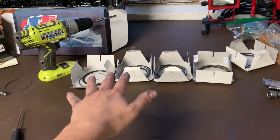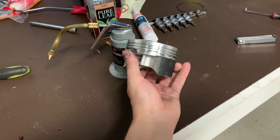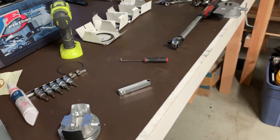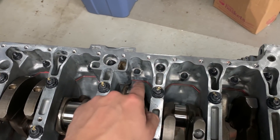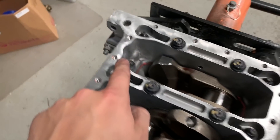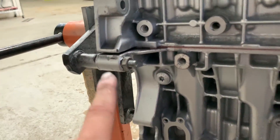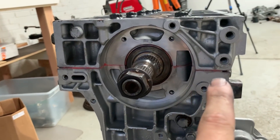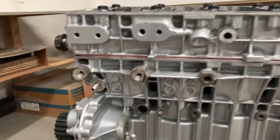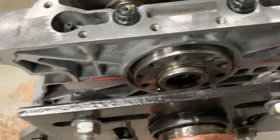Everything is all assembled now and is ready to put the pistons in. I went ahead and double-checked — actually this is my third or fourth time checking all the gaps. I did that off camera, and next video we're going to be putting the pistons in and I cannot wait — these things are freaking gorgeous. This is how you know the crankcase is sealed properly: when you see a little bit of excess anaerobic sealer oozing out into the crankcase, going all the way around the perimeter on the inside and also on the outside. This is how you know you're not going to have any leaks out of the crankcase — I applied enough and torqued everything down evenly so the gasket maker oozed out properly.